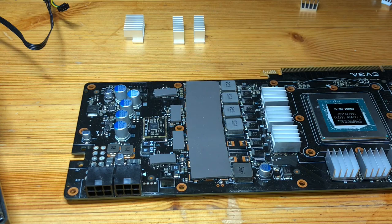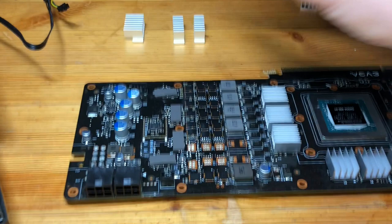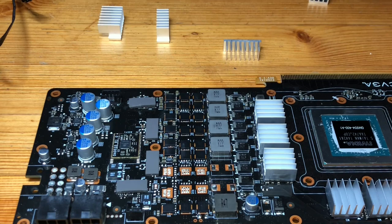The reason why it's dangerous for us to proceed is because there's a lot of inner circuitry here, and we just have to be sure we're not going to short it out by using the heat sinks. While the chip modules are fine, here I'm going to zoom in, there's a number of other inner workings that you can see, such as right along here and there. But we're going to take steps to help insulate those areas, be sure they are not getting electrical connectivity and can overall be cooled.